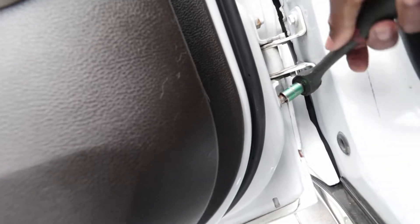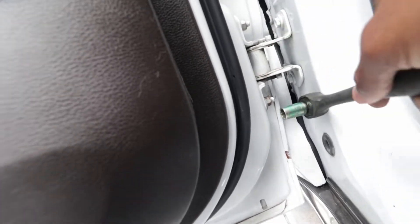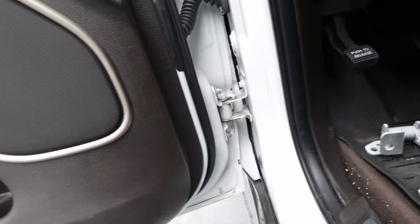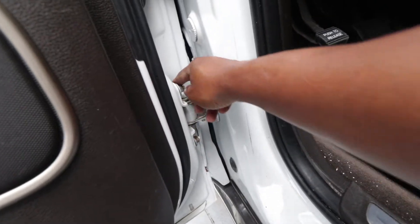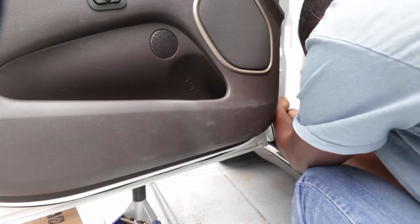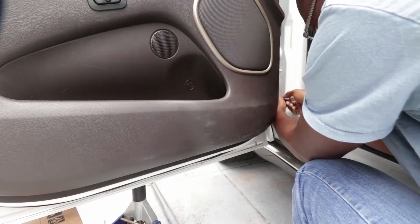I'm going to go ahead and try to loosen these guys up, and hopefully the door doesn't crumble or fold or do any weird stuff. I also imagine it's probably going to be kind of difficult to get this guy out of here — it's on studs. Sorry I can't give you a real close-up look because I can't get the tripod in a good position. Basically, next I'm going to loosen up these bolts and see how much room I have to wiggle that bracket out of there. The back bolt is kind of way back there, so that's where this ratcheting wrench comes in handy.